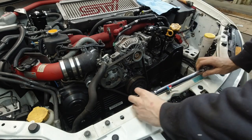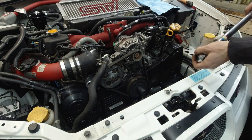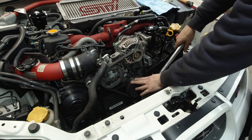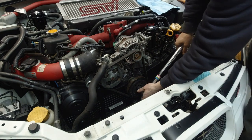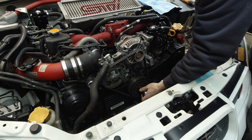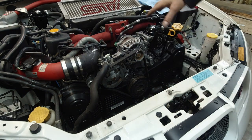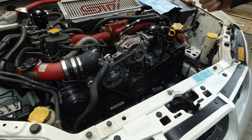That was kind of a test — you saw it working down to 100, that's as far as that torque wrench range goes. I have another one set to 132.8 — I'll just do 133. To do this I had to put the car down on the floor, put it in 6th gear, and apply the handbrake.